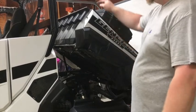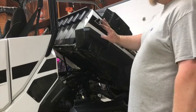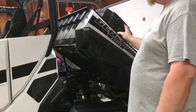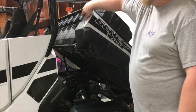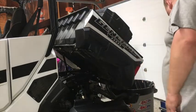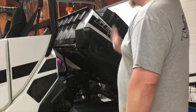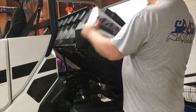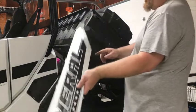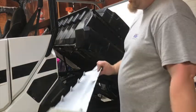The backs are not hard, but this white trim piece needs to come off first. It comes off super easy — don't try prying it or pulling up on it. There's just one T40 screw; take it off with your impact or hand tools. This isn't even a snap fit, it literally just pulls out. When putting it back on, you tuck this into the back — you'll see the little pocket — and the whole thing sets right back in place.